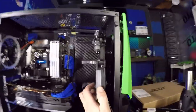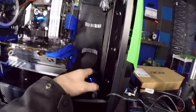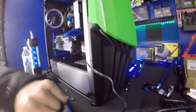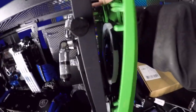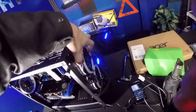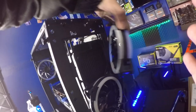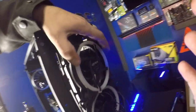If it goes here, this is where the pump is — there's not enough room for a fan, it just will not fit. So what I thought about was running kind of a weird configuration: putting one fan down here at the bottom to suck air through the front, and then for the top, putting the fans on the outside of the radiator.